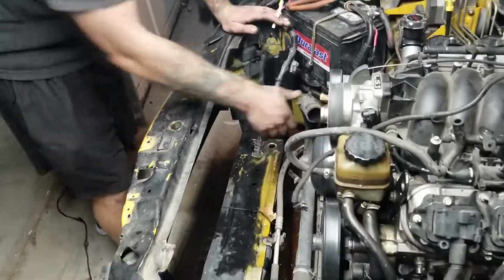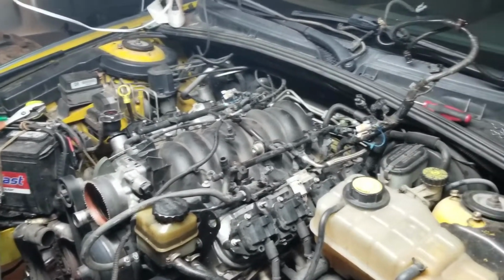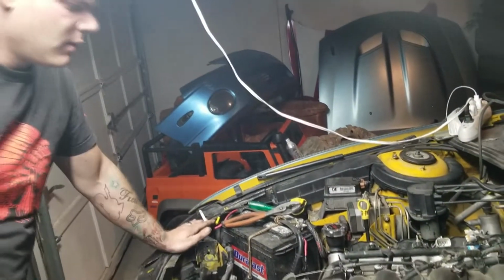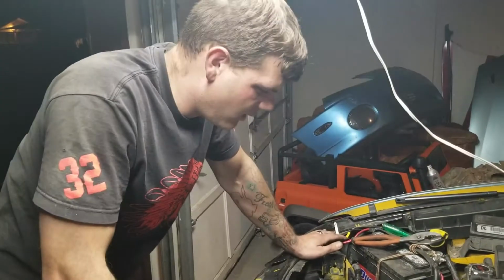All right, guys. So we got the radiator out and started getting more of the hoses off. I still gotta take some more of these hoses off for the coolant ports. After that, it's not that far off. I gotta take this thing off the AC thing, get the plug out of the alternator, and then move around to the backside and unplug everything for the transmission. After that, it's pretty ready to get pulled, I guess. This is my first time pulling it, so I'm sure we'll run into some things we weren't aware of. But we'll take it as it comes and get her knocked out.